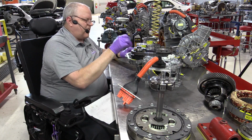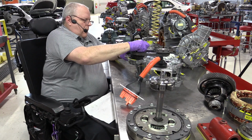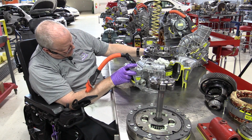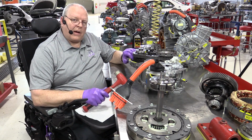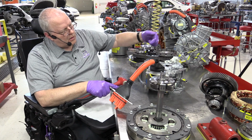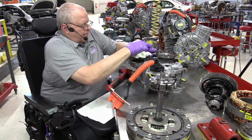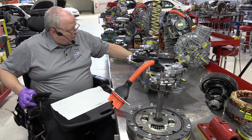I can see that the shaft is pushed in that way too far. There we go. If I pull it back, the chain should be tight. It's still back too far. Now, I'm breaking my own rule here with the hammer, but I'm not going to hit down with this hammer. The problem that occurs is that the shaft gets tilted in. And so if we can, there we go, just tip it back up vertical, then we're down in. I wasn't strong enough to do that on my own.